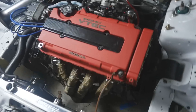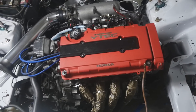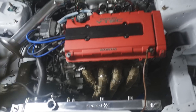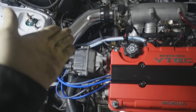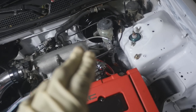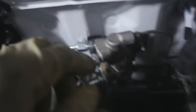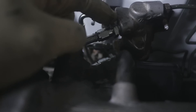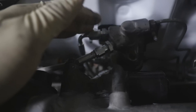It's now like day 97 — I lost track of time. Everything I would say is done: everything underneath, the exhaust, the shifter — everything is installed properly. The evap canister is still there and I managed to put that back on. I sorted out all the leaks I was having with the Valix racing kit. You've got to really make sure both fittings are tight — tighten up the nut and then tighten up the other piece, or else it will start to leak.